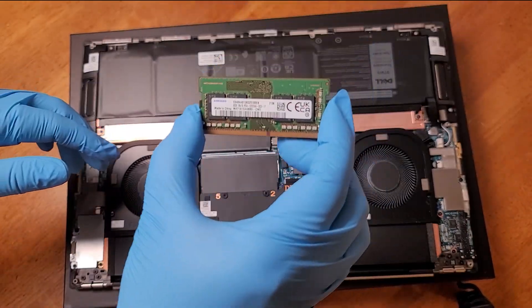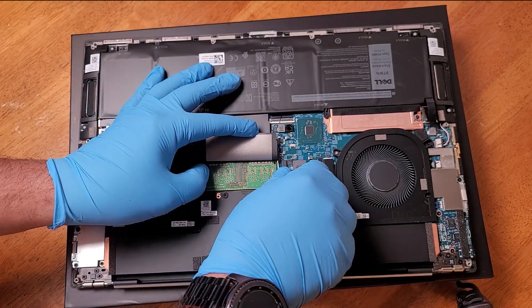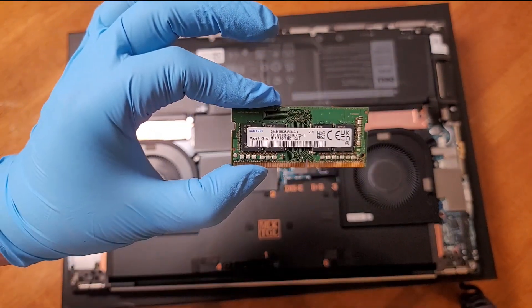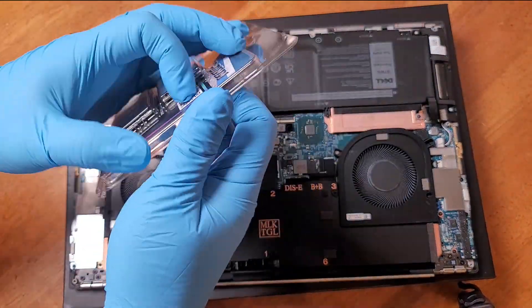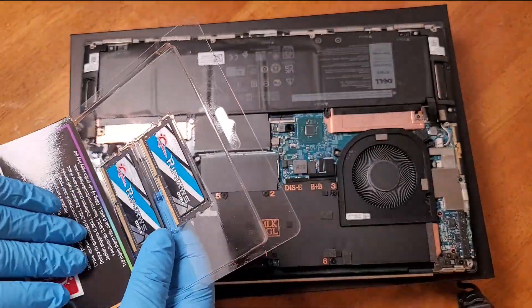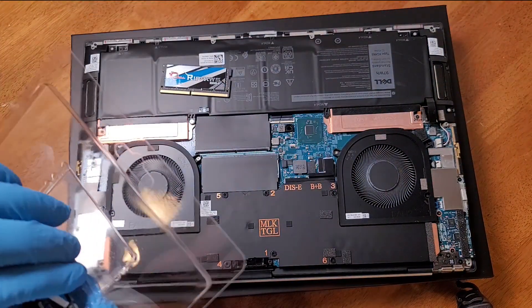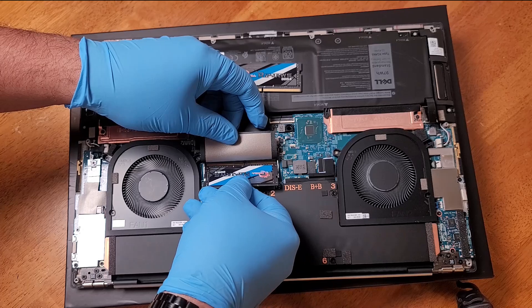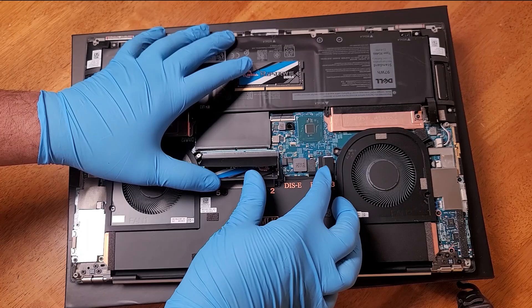Now let's talk about this amazing PC's specs and the upgrades we're going to do. This PC comes with 16 gigs of 2x8 dual channel DDR4 3200 MHz RAM, which is upgradable to 64 gigs. We're going to upgrade that using the G.Skill Ripjaws series 64 gig 2x32 gig at 3200 MHz — link in the description. This is the best upgrade you can do to this laptop. The specs match and the voltage is also 1.20 volts, just like the original memory. With all that extra memory, my render times are going to come down as I do my video editing on this laptop.